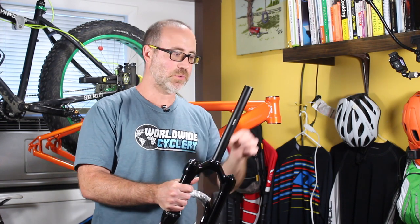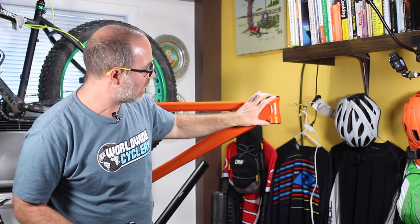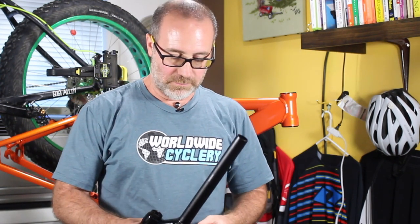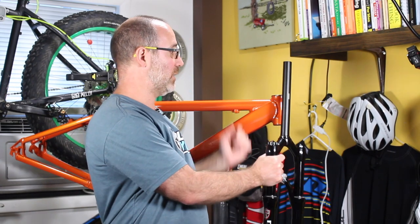When you buy a brand new fork, the actual steer tube is going to be pretty long because they don't know how long you want it, or how big the head tube section on your frame is, so it has to accommodate that. You're going to have to cut it one way or the other. Once you cut this, you're done — you can't put it back on. Unless you know you like it at that length and don't ever want to use the fork on another bike, I always leave it a little bit big. You can use spacers to adjust it. I try to leave a little extra. Once you commit to a shorter length, you're done, so I try to err on the big side.